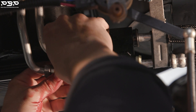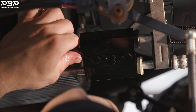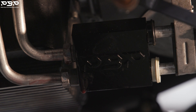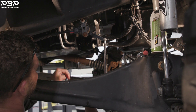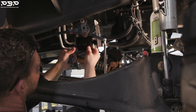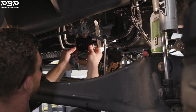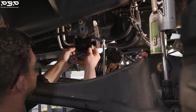To make it easier, work the top hard line first — once it's seated you'll have slack. Thread it on and get it hand tight, as tight as you can by hand, to slow the leak so you can wipe things down. Then work the bottom line — it goes in easily because the top line aligns it. Wiggle left to right to help the threads engage.